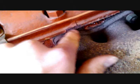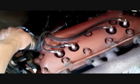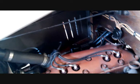It hasn't been restored for 30 years, so yeah, it's run pretty well considering. There's the motor for you — same spark plug just here. Whether that means the block has rusted away so much that water from the water galleries is starting to get into the cylinder, we're not sure. But I think I've eliminated most of the other issues — I've cleaned all the spark plugs, cleaned all the points on the magneto, taken all the jets out of the carby and made sure they're not blocked, and cleaned up all the petrol lines. So nothing's stopping it that way.